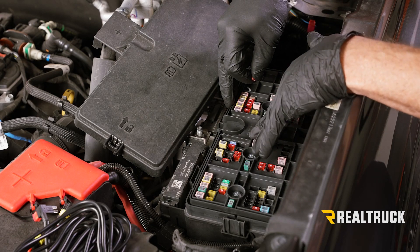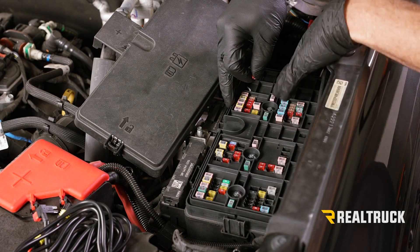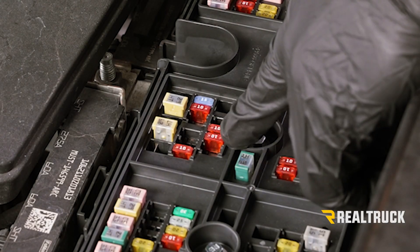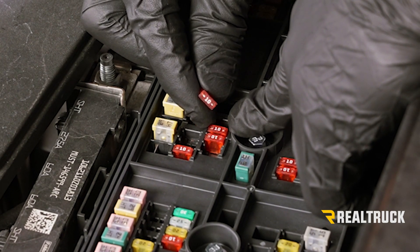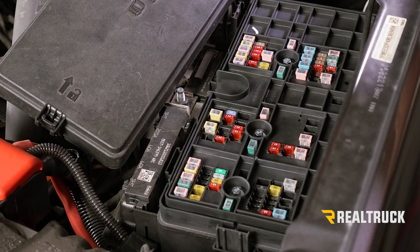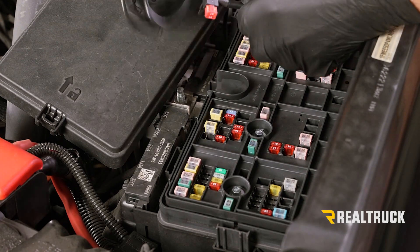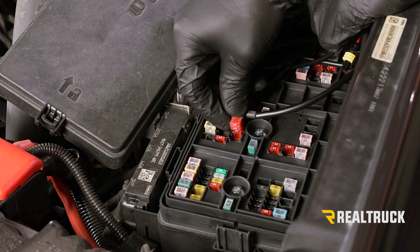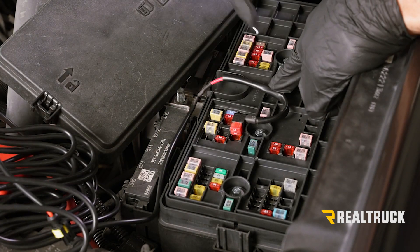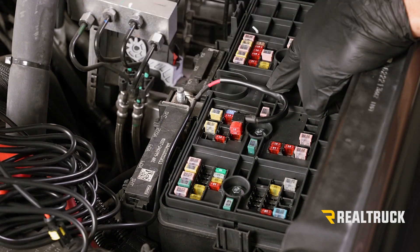Now here we are at the fuse panel underneath the hood. This is on the driver's side, and this is the front of the vehicle. With the fuse panel lid already pulled off, if you look at the second mounting location directly in front of that, you're going to see three 10 amp fuses. The third one back I've already got pulled out, so we're going to set that to the side. In our kit we're going to have a double fuse tap — you've already got two 10 amp fuses here. We're going to plug that in to that location and then run it out this way. It might be a good idea to notch out this little area right here so whenever you put your fuse panel cover back over top, it doesn't pinch it.